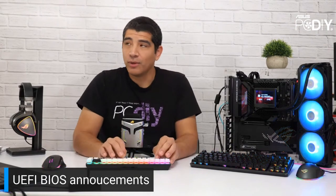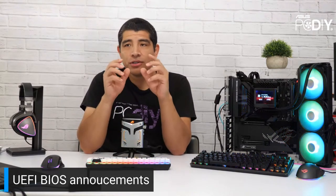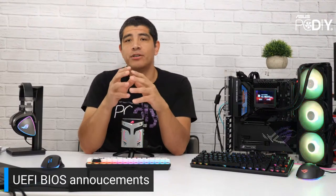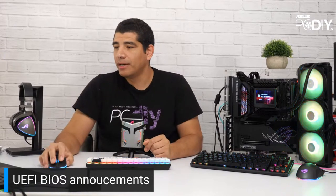Now, one of the things that you do want to be mindful of when we talk about these updates is that on occasion, we will release updates that also include supplemental firmware. We talked about this, I think maybe a couple of weeks ago, where I talked about additional firmware for the Thunderbolt controller and the USB PD functionality. But this specific new update that is being rolled out for 600 series also contains firmware for the Aura RGB controller that we have on the motherboard. Some people don't realize that there's a small microcontroller physically on the motherboard that provides the management and functionality for RGB lighting. On occasion, we will enhance this and improve its performance by releasing a firmware update. So let me show you what that looks like.